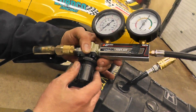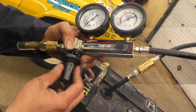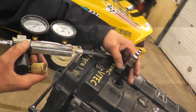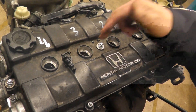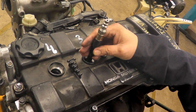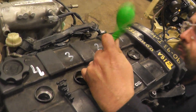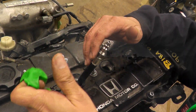At this point we are done with cylinder number one. Unlock it before you disconnect. Make sure before you disconnect, turn this all the way back to zero. Then disconnect the compressor and pull the hose out. The firing order for this engine is 1, 3, 4, 2 — meaning number one fires, then three, then four, then two. We already did number one. Without spinning anything, put the gauge in number three, because that's the next one coming up on compression stroke. We put the balloon back on and spin the crankshaft to confirm, then repeat the procedure for number three, then number four, then number two.